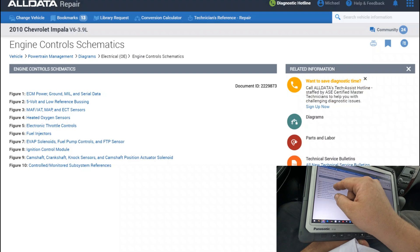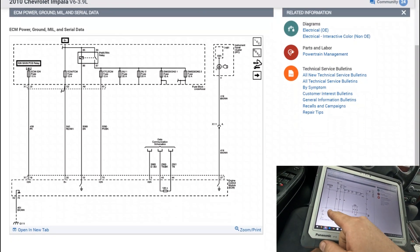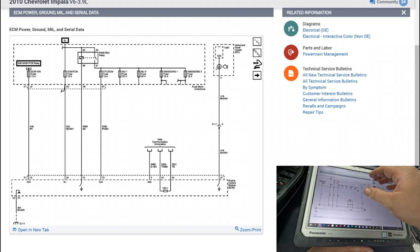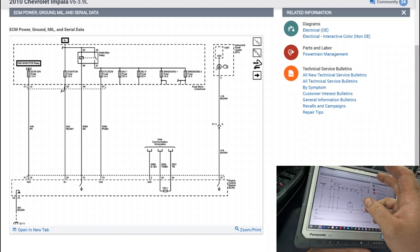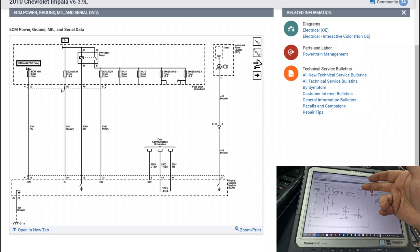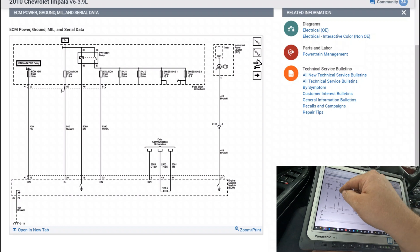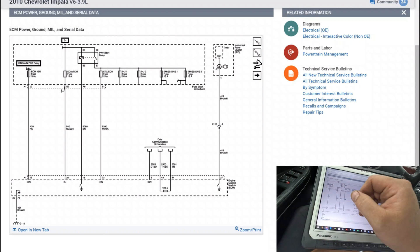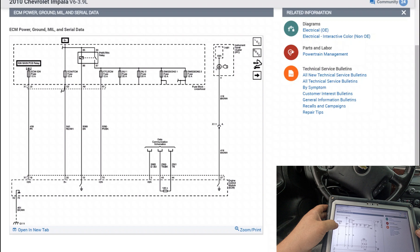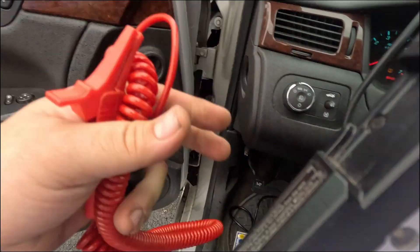It's probably either missing ignition power, something wrong to the ECM, or just a bad ECM. I'm pulling up another diagram for the ECM power and grounds. We have an ignition power, a B+, another ignition, a wake-up signal for communication, and a switch ground. The instrument panel gives ignition power to the check engine light and grounds it. Let's check these fuses first - the ECM-TCM fuse and the ECM ignition fuse, all under the hood.